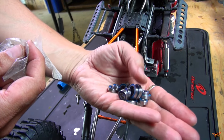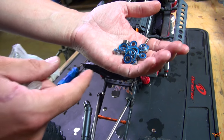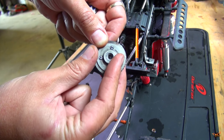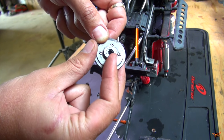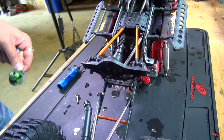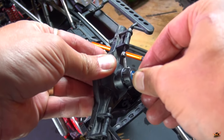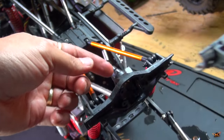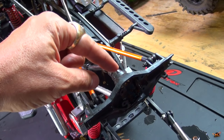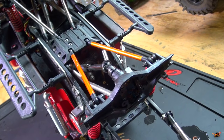As part of my kit, I always have bearings on hand. With the new bearings in place — one there, one on the inside right behind the pinion — no slop or play. Everything's ready to be put back together. Before I do that, just for some maintenance, I'm going to go ahead and remove the pin off the drive shaft, slide it out, and also remove the two bearings that are here. That way when I reassemble it and go back into the mud, I know I'm not going to have a problem on this side and everything's been done in one fell swoop.